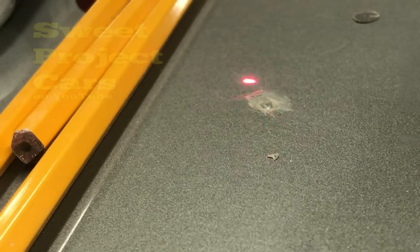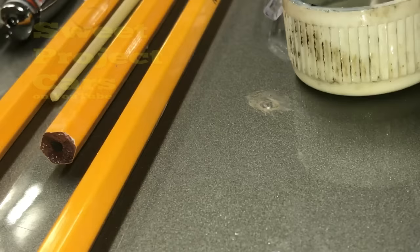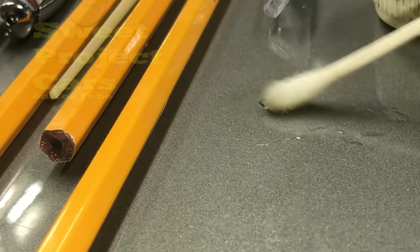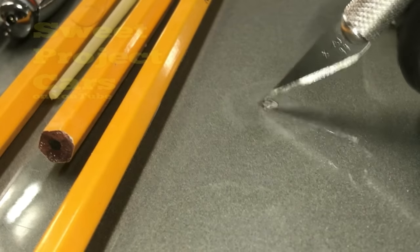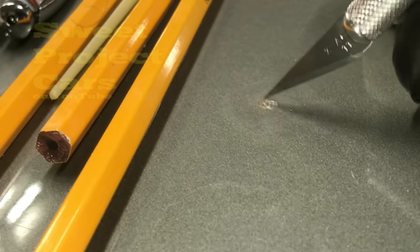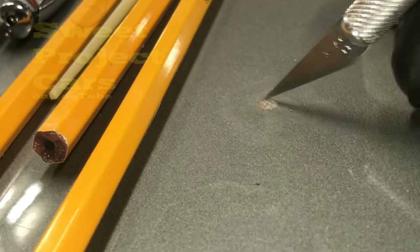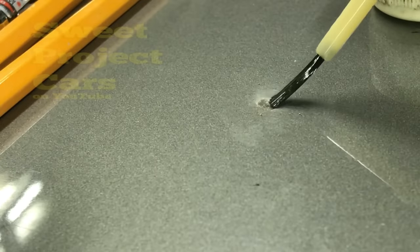Take your color paint and fill it in until it's just higher than the outside body paint, because you're going to do the next step. When you have chips with rust in them, you have to use an etching primer if you have bare metal. You will not have rust if the primer is still there. You do not do anything on your vehicle until you've cleaned it with rubbing alcohol — even if you've washed it.